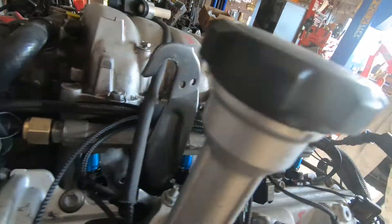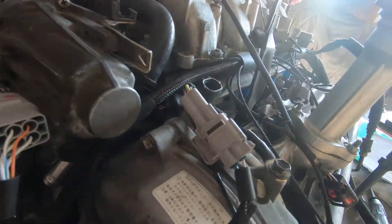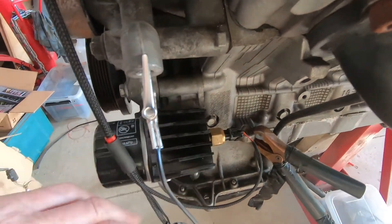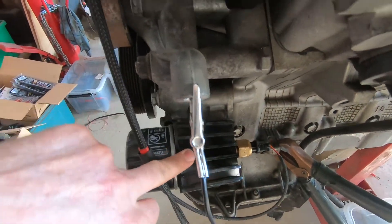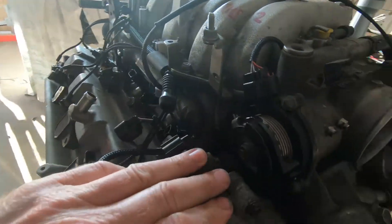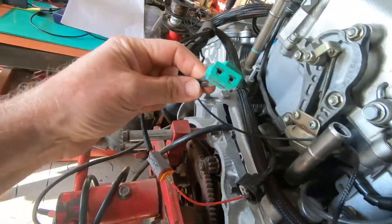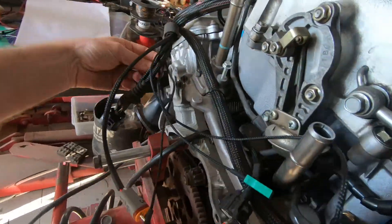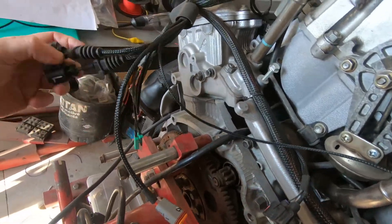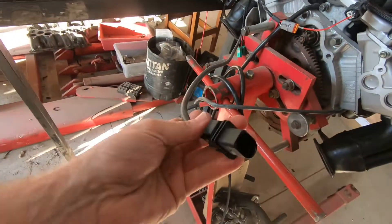The loom's looking like this, yet to be plugged in. It's got some ID injectors, fuel pressure sensor, oil pressure sensor, and it's actually going to have that filter block on it. Drive-by-wire throttle, thermocouples — got to sort them, they're yet to be configured — and twin widebands.